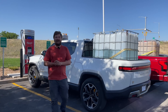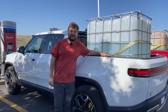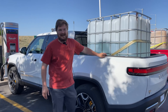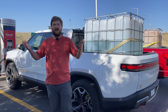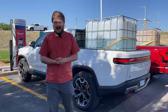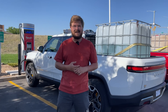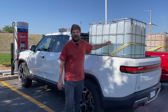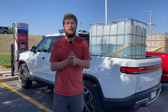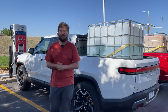Hello and welcome back to another Out of Spec Reviews video with my Rivian R1T. A question we get asked a lot is: what is the range at maximum payload? When you load up the maximum capacity the truck can handle, what is the efficiency? If you go back a couple videos — or even just yesterday's video — we ran this exact same loop unladen, totally empty, and got 2.15 miles per kilowatt-hour at 70 miles an hour on the 22-inch sport wheels.